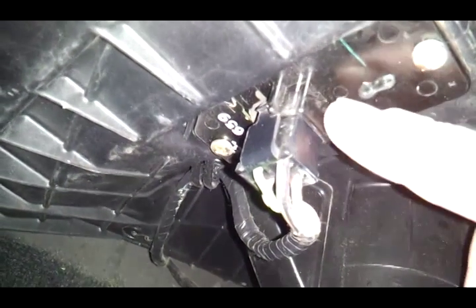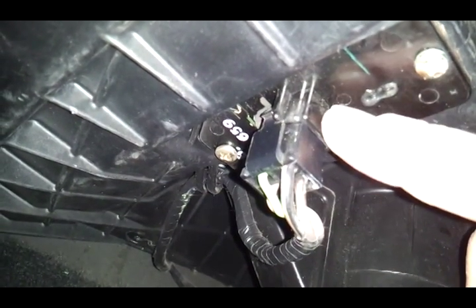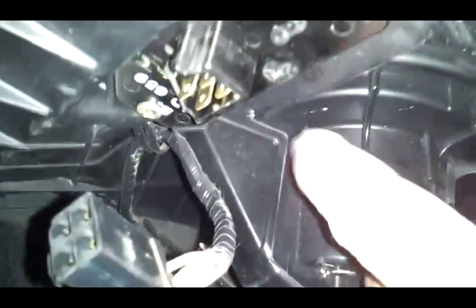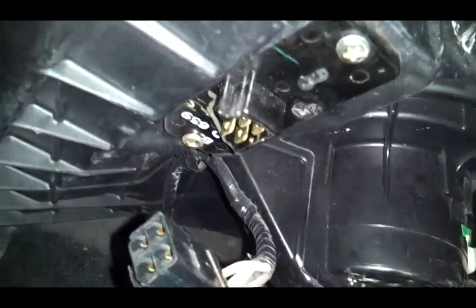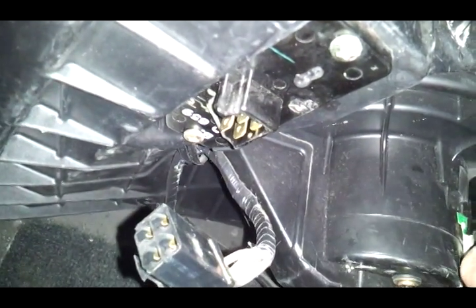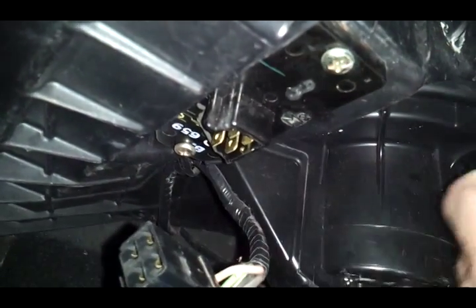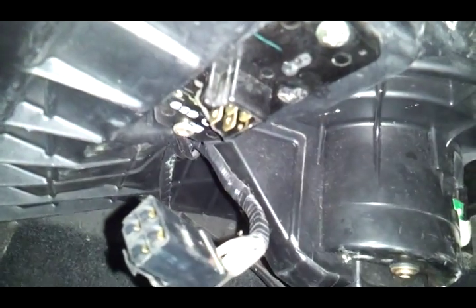So that's a problem. It's kind of spendy, so get one from eBay or have AutoZone order you their cheap one for $33. Their stocked one is like $60. It's just a wire wound resistor, so don't sweat that. There's no mechanical components whatsoever. As long as it's intact, it'll work. If your heater fan blower does not function in all speeds, most likely it's this component right here under the passenger side dash.